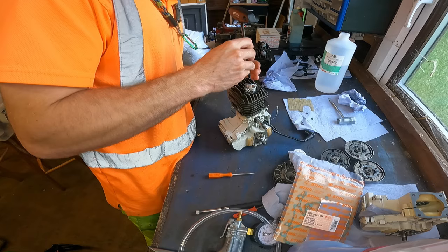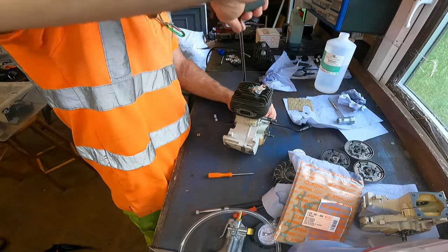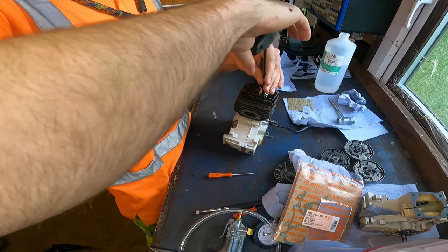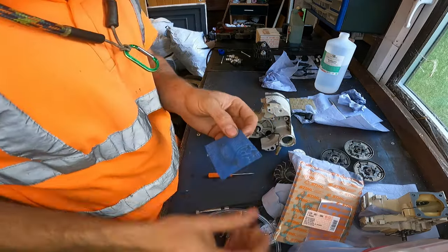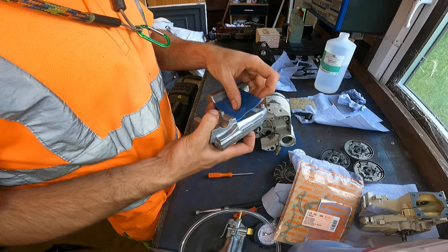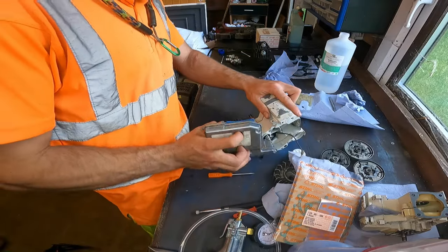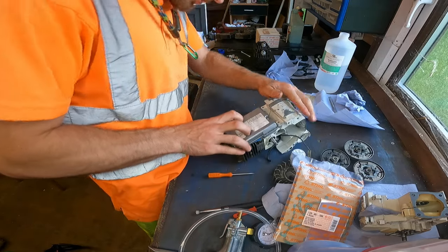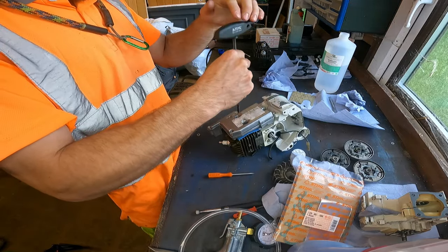I'll go back in there. Down. There we go. For the pressure test, we need a bit of rubber, muffler, just literally make two holes, poke the screws through, make sure you get this the right way, that'd help. Down onto the muffler, our trusty T27. Just tighten them up.